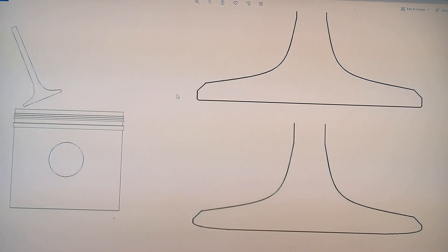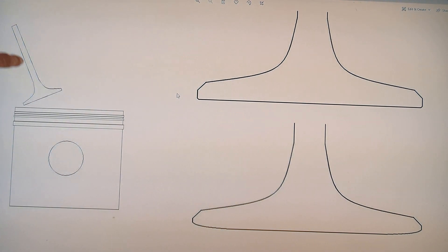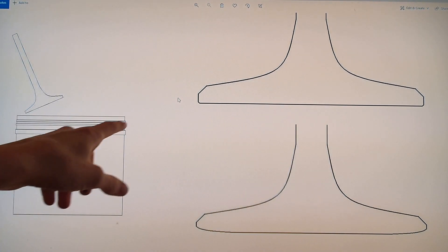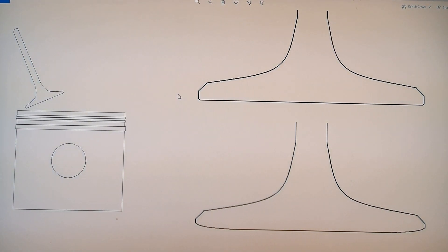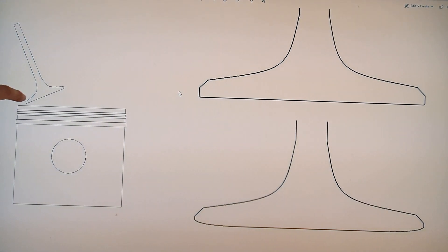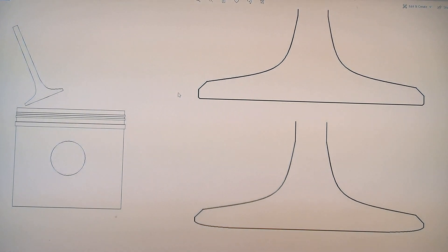Once I had the engine open and I was going to do the job anyway — here you can see the valve is inclined at about 11 degrees to the piston. So it's only the edge of it that would make contact. That's further complicated by the fact there was a bowl in the piston, but it would still be very near this top point. So I can add a thicker head gasket, which I didn't really want to do for various reasons. Or I can remove material from the valve, or I can remove material from the pistons. In the end, I went with both.